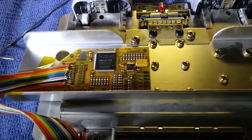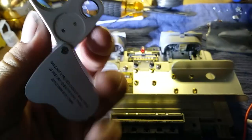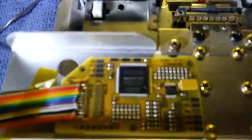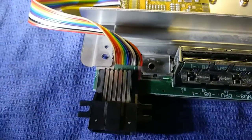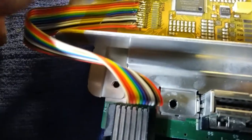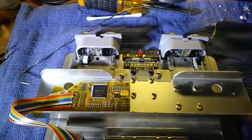I've got the RGB output board mounted up to the heat sink and the wires soldered up. This has all been checked with the meter. It's been mounted to the heat sink with the double-sided tape that the board comes with. I'm going to use a little bit of Kapton tape to secure the wires and put some bends on the ribbon cable so they'll tuck behind the heat sink. One thing I noticed — this edge here is very sharp and I de-burred it on both ends because there will be cables going by there. The insulation should be thick enough, but just a good precaution. Then we'll clean the whole top with IPA before I try to stick anything down.